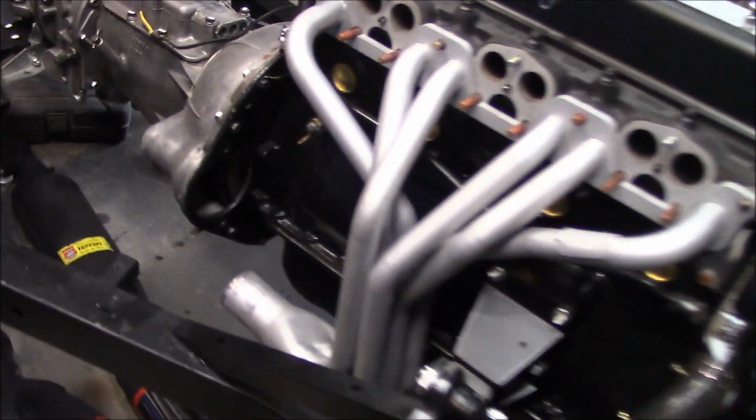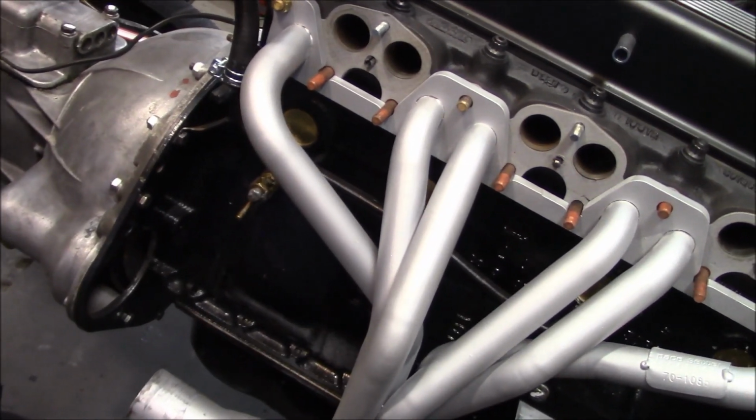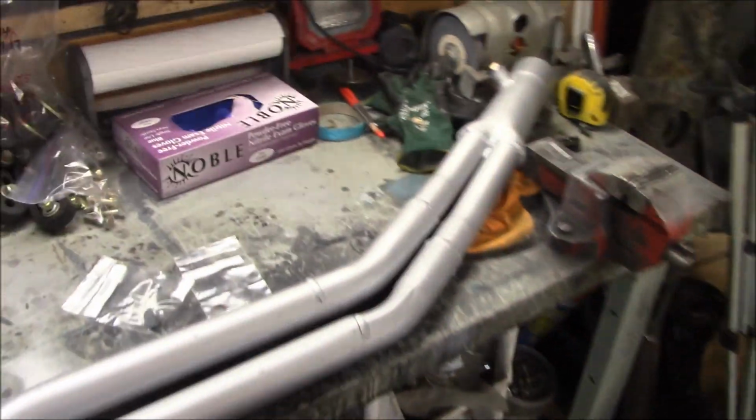So you might recall from a previous video, I got a new drain plug for the side of the block since the petcock over here is leaking, and I've just got it plugged up with some JB Weld at the moment. We're going to replace that petcock just with a plain plug. So we'll go ahead and do that now. I'm expecting some coolant loss. We've got a little bit of a bucket here. We'll try to catch that.